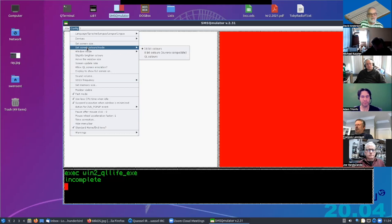Aurora was, so when you've got the basic QL, you'd buy something called the gold card, super gold card. That was an add-on, gave you additional memory, floppy drive interface, and it gave you a faster CPU. Well, after a while, motherboards were getting kind of old. So someone said, well, gee, if I take the gold card and build something called the Aurora, I no longer need the base QL. I can put them together. Now I have a whole new system running a whole lot faster, and it had better graphics. I've got it set for 16-bit colors, but rarely use it.